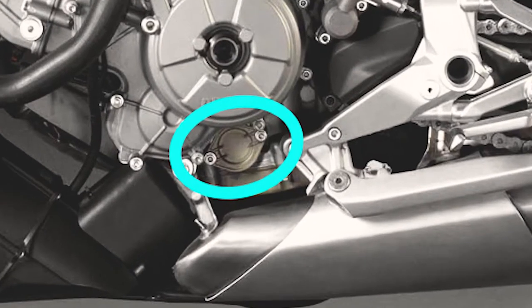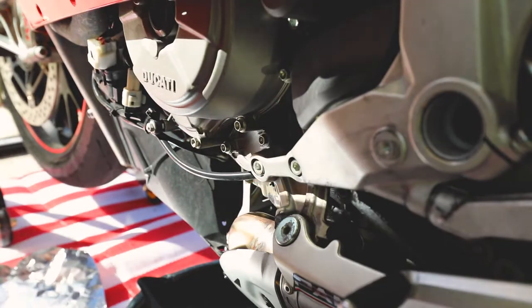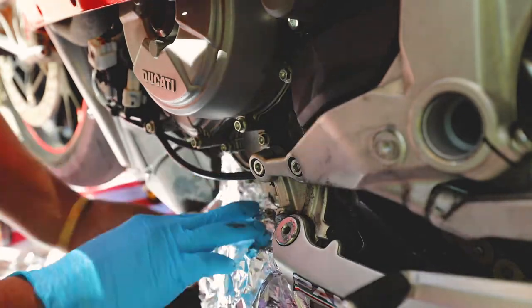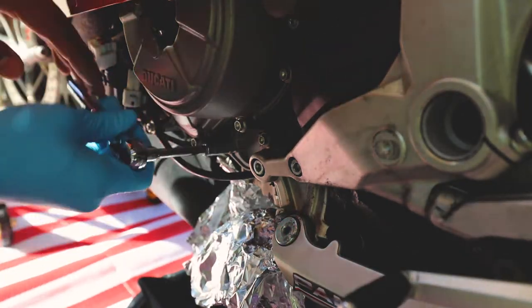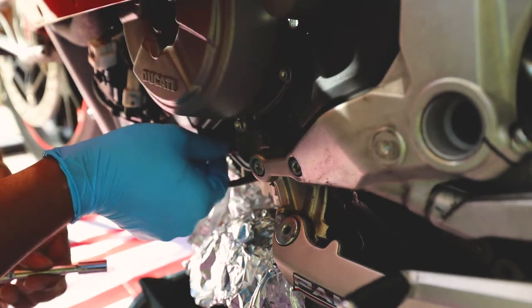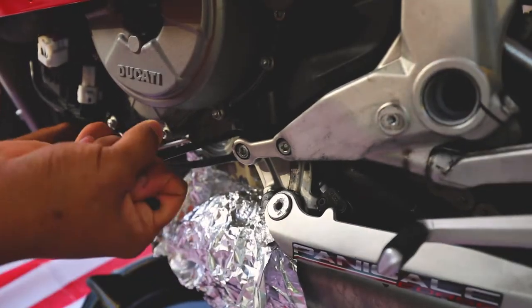On the right side there are two bolts on the filter cap — go ahead and remove those using an 8 millimeter socket. If you have a newer model, I believe 2014 or 2015 and above, the filter cap has its own thread which makes it a lot easier to remove. Since this is a 2012, I don't have a thread on my filter cap, so I'm using a spring hook. Before removing the filter cap, cover the portion of the exhaust so you don't spill oil. Using the 8 millimeter socket remove the two bolts rotating counterclockwise, then use a flathead to loosen the cap and pull it out.